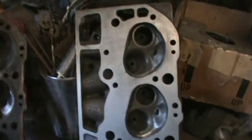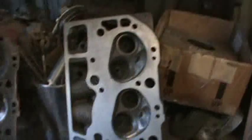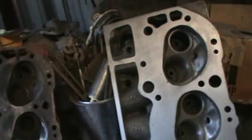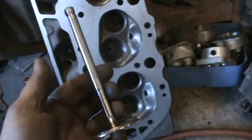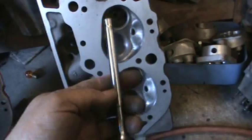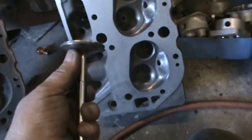You're not going to remove a lot of material with the sanding drum, and if you try to, it's going to get wavy on you — like tin-foil wavy. The other thing that's really critical if you're going to run an aftermarket valve spring and a camshaft with any kind of lift is a stainless steel valve, something that's not two-piece. A lot of people don't know that most passenger car valves are two-piece — they have a head and stem bonded together. That pulls off if you add spring pressure. That's why they go to a stainless steel, one-piece construction valve.